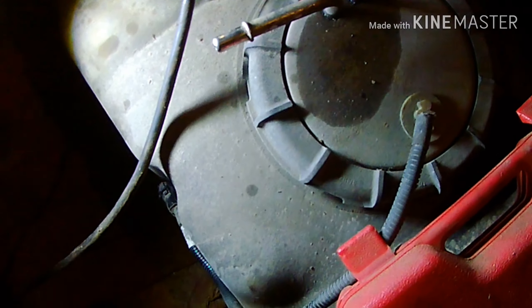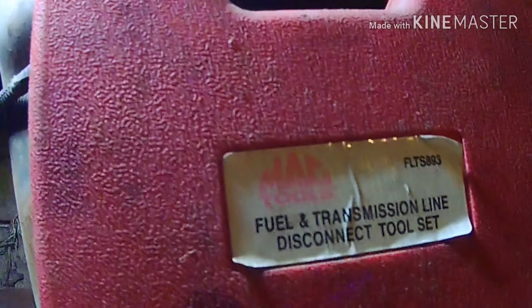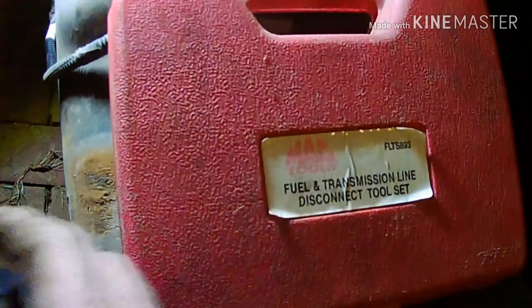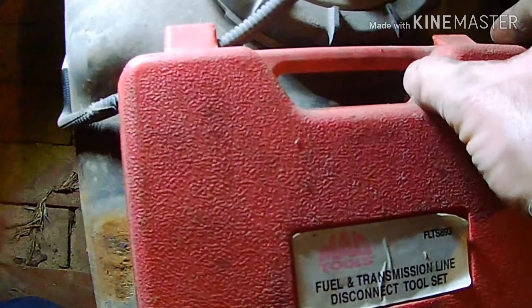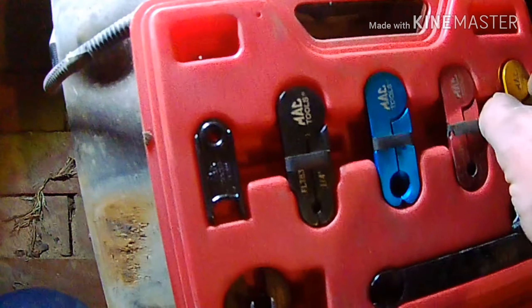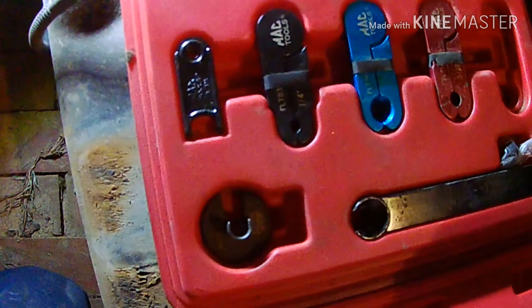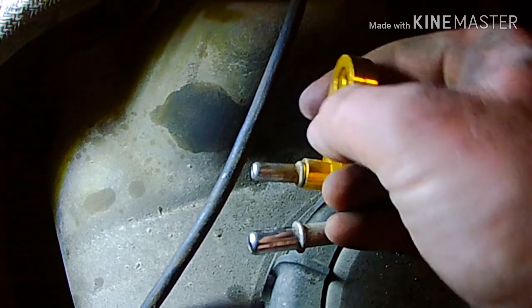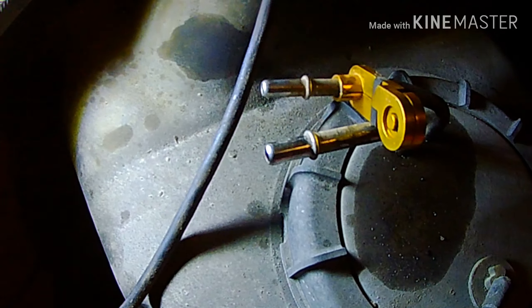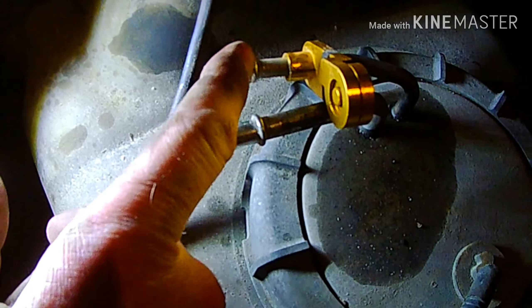These lines on the vehicle — I haven't done mechanic work since 2004 — but Fords like to use these quick-connect lines and you need a special tool. I bought this set back around 2000 from Mac Tools, got pretty well ripped off on price, but you can get these now at AutoZone or Harbor Freight. What you do is — Fords have fittings similar to modern SharkBite plumbing fittings — it has a little ferrule or flange there.